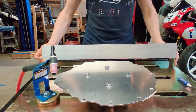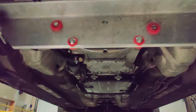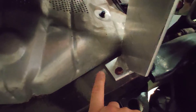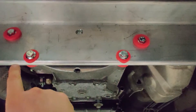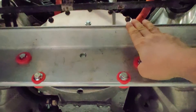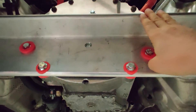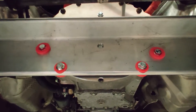Let me install it in the car and show you what it looks like. The transmission is fully mounted now. The bracket is attached by four bolts — two large ones in the front from the subframe and two smaller ones on the back — and the transmission is attached by the four bushings. This bracket is extremely strong, and I'm also going to use it to support other components, like the battery box, whose back end will most likely also be attached to it.